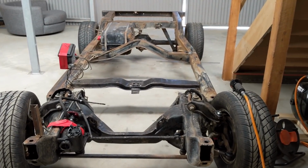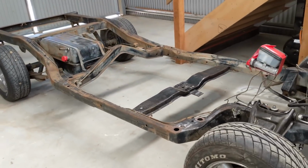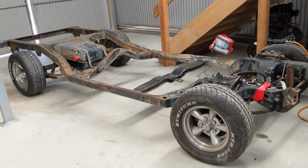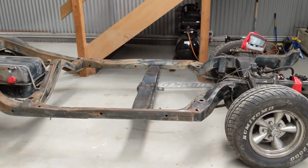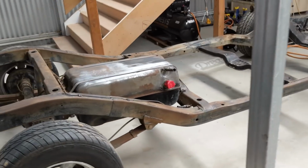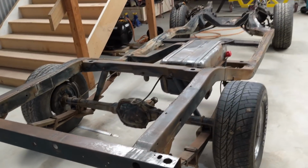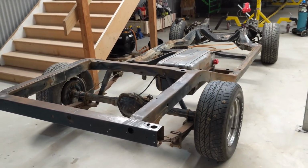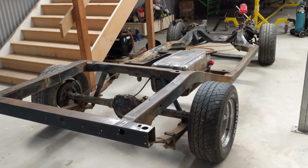And what it does is it'll spray a 360 degree fine mist of this KBS coating, and it'll coat all inside of your chassis rails as well. You can clean them best as you can. Unfortunately, you won't be able to get a lot of the surface rust if there's any inside, but all you can do is try and trap it in there and make sure that it can't breathe, and hopefully it'll fight it off into the future. So anyway, that's an update on the chassis, and now we'll move on to the chamber.